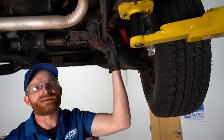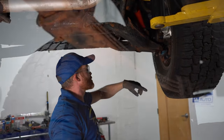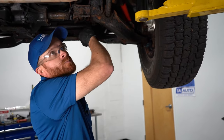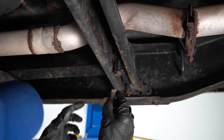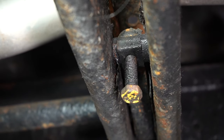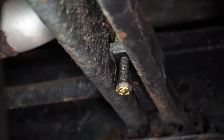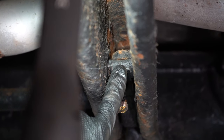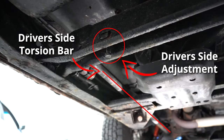Different types of vehicles are going to have different types of front suspension. Some vehicles are going to have torsion bars like this. On other vehicles, you might find coil springs up in the front, or even on older vehicles, some leaf springs that go across the front. Leaf springs are generally something you're going to see on the rear of most passenger trucks nowadays, but on the front you're probably going to see coil springs or torsion bars like this. If you've got torsion bars like this, this is the video for you. The adjustment area is going to be located behind the transfer case on most pickup trucks. You're going to find a bolt that looks just like this right here, and if you tighten it, it's going to push up against the little lever on there, which is attached to the torsion bar leading all the way to your front control arm. What you'll probably notice is this adjustment is completely de-adjusted, meaning it's pushed all the way down, giving us the most amount of rake with the front sitting lower than the rear.